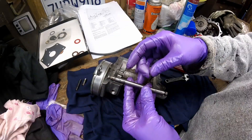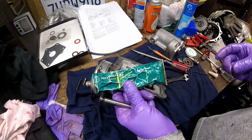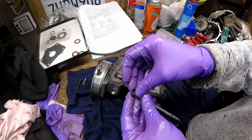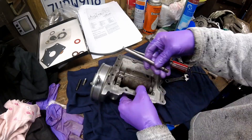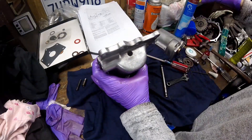Next, the shaft pin goes in and takes a flat rubber O-ring in this groove here. I always put O-ring lubricant on them. Now it's got some O-ring lube and it just slips right on. That's what it looks like once it's on. This goes into the drum over this side before I slip it in.